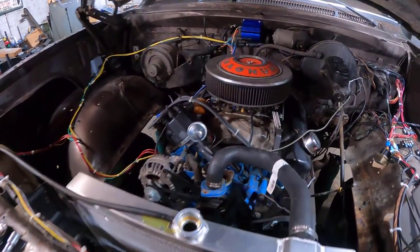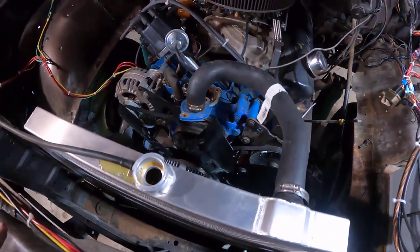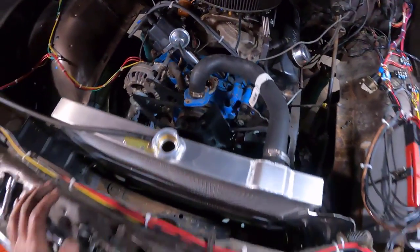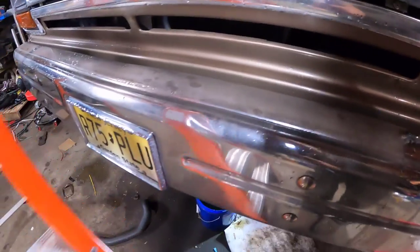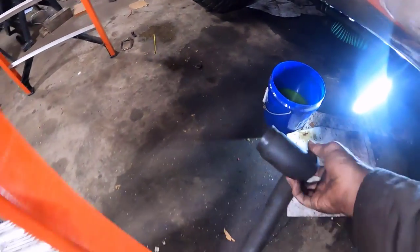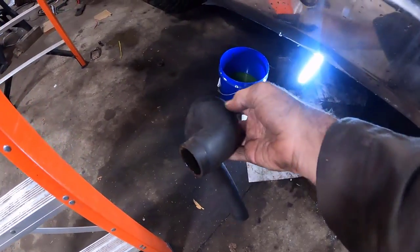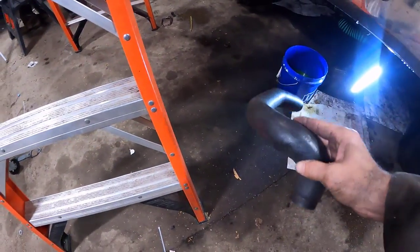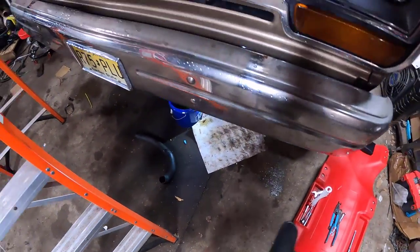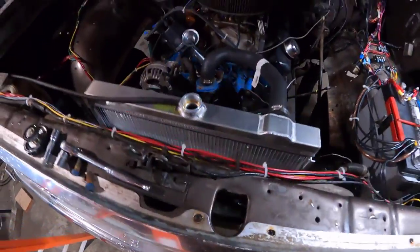We jump right into doing our thermostat. So we ended up draining about a gallon of antifreeze out of the bottom of the radiator. And pro tip, I like to save old radiator hoses. A lot of the time I use them for insulation, for cables or smaller hoses. This time, I just went ahead and held this thing against the petcock like that and let it drain into a bucket instead of making a big mess. It worked out great. So I'd recommend that.